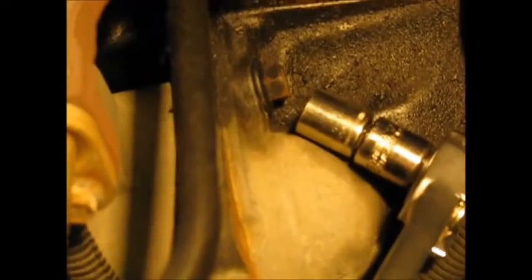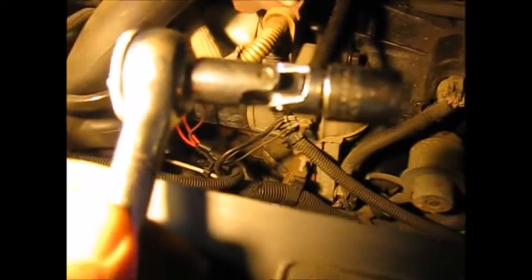The filter is out and I have a catch pan here. We've got the perfectly accessible 15mm upper bolt, which I have a half-inch socket on — it's already busted loose. Here's the bottom bolt, visible below the starter right in the middle of the frame. For this one I'll use a 3/8 inch ratchet with a swivel to the 15mm to get on that bolt.